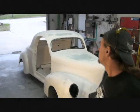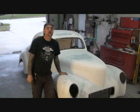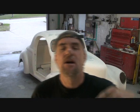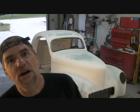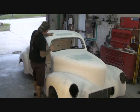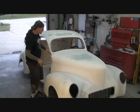Okay, now, if you look at this car, this is an example of a fiberglass kit car, okay? It doesn't matter if it's a Street Beast, a Downs Manufacturing, a redneck fiberglass car, and all these other companies out there, Harwood, Inglewood, and Lakewood. Every fiberglass car you do, you're going to have to do bodywork to it, okay? And the place that it takes is wherever the release mold goes together, is where the bodywork is going to need to be done.